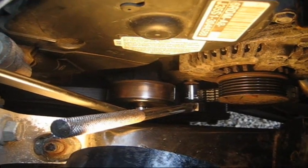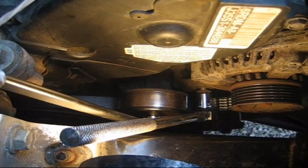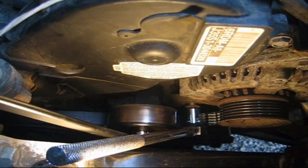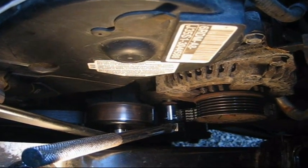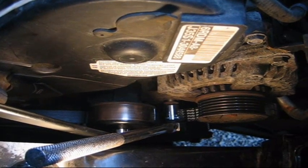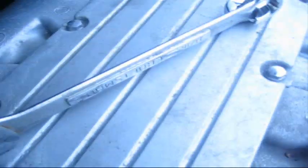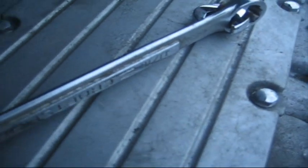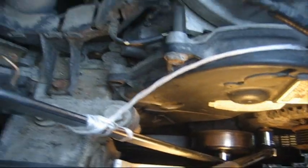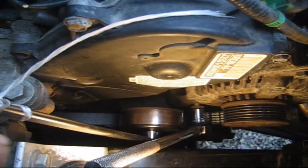Alright guys, it's day three. I went to the auto parts store the other day to get the alternator — they didn't have it in stock. What I did was pick up a belt and gave it a shot to see if maybe the belt was slipping. But I put the belt on and the light came on — it wasn't giving the full charge. I was able to loosen this belt tensioner with the two wrenches, using a wrench on the bolt and another wrench for leverage. While I was there picking up the belt, I picked up a loaner tool. What I'm going to try to do is get this alternator out without lifting the engine up.